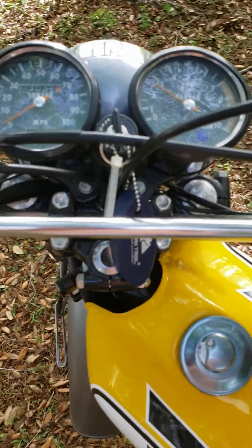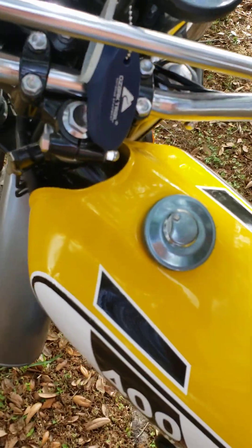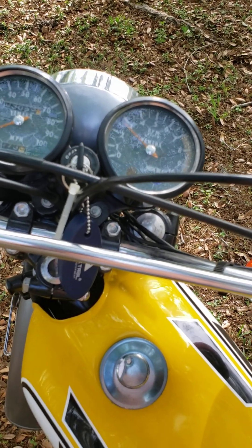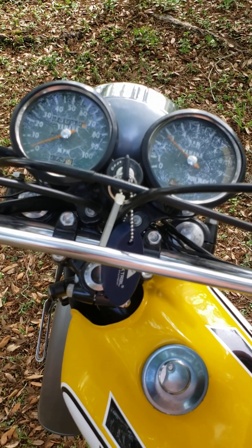With the big bore 400, they've got all sorts of compression. We took out the automatic compression release above the exhaust — that was all gummed up. Took it off, cleaned out all the carbon, put in a new o-ring, and put it back in.